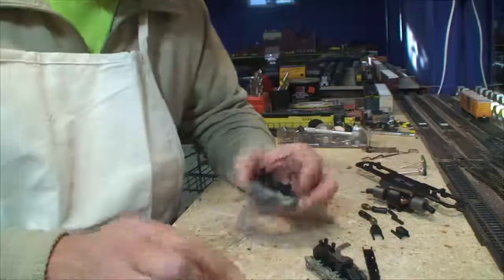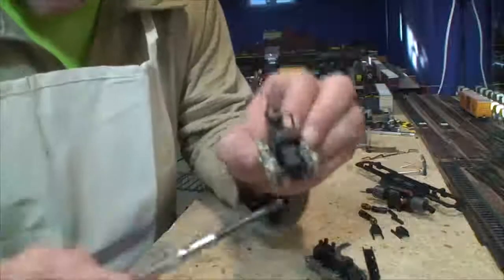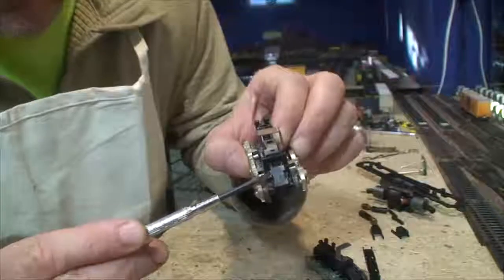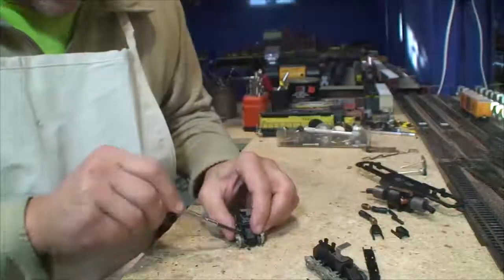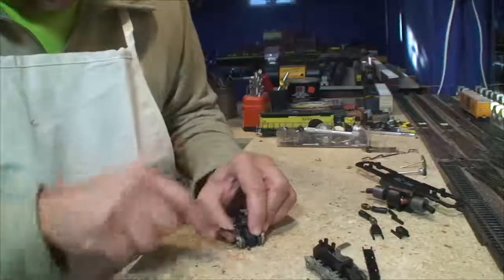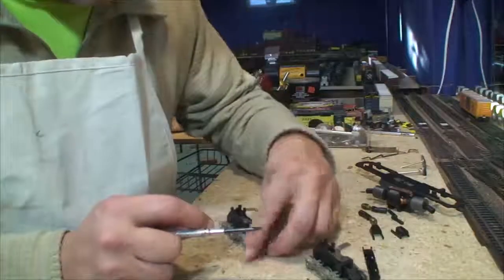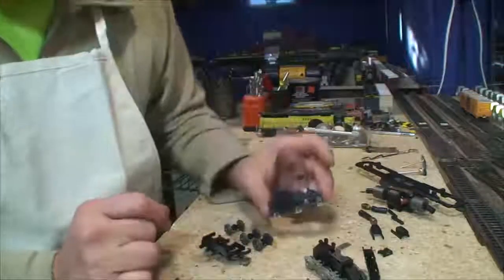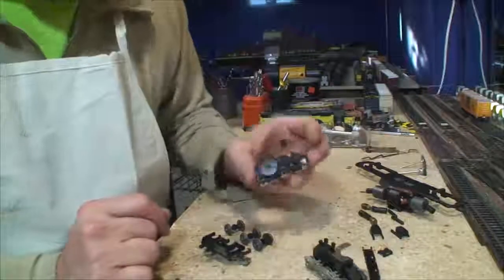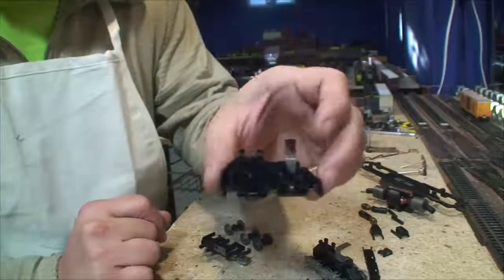Now that's key with this. Here is a clip right here. Do not go in the back side, or you will break it. Go in from the side, above the wheel. Carefully — a little twist comes right off. Now everything comes apart. There are only three gears in here. If you are not sure how they go back in, just take a picture. You can refer to it later.